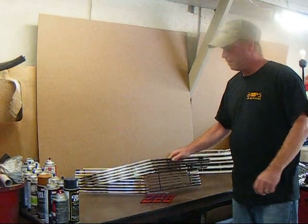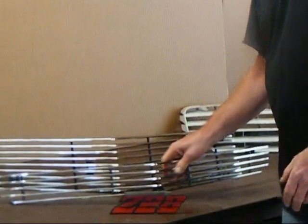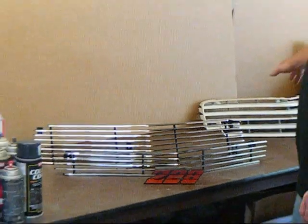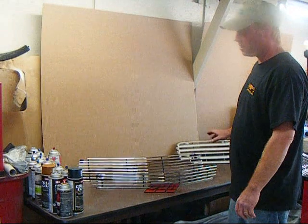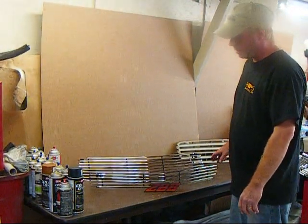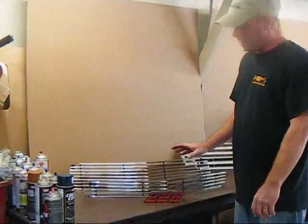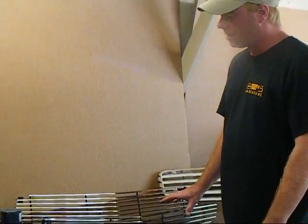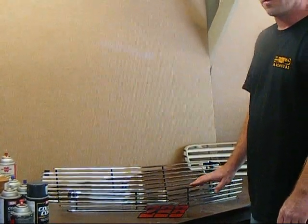What we're going to be installing today is a new replacement upper and lower billet grill. They're nice units — heavy, made of metal, not plastic. On your factory 80-81 Z grill, the upper grill is now roughly $200 and the lower grill is not reproduced, so if you have damage to your upper grill or are missing your lower grill altogether, this is a great option. Note that 78-79 and 80-81 grills, while they look the same, have different mounting tab locations, so it's important to order them for the correct year.